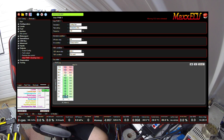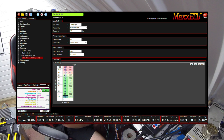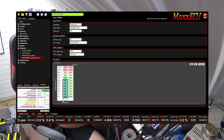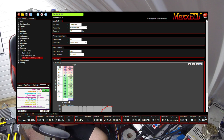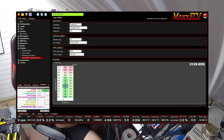You can see I've set the frequency at 120Hz — these units just work fine with that frequency. These numbers are the duty cycle of the PWM. It's a table I brought over from something that had air conditioning, so you can see when air conditioning is active it adds more PWM to run the fans to cool the condenser. In this case we won't need that, but you can see it's at 0% all the way up, then we start getting to 70 degrees — soft start brings the fans on nice and slowly until a hundred percent. What you tend to find is it sits just after where the thermostat opens, which is exactly what we want.